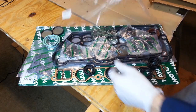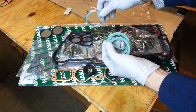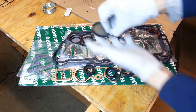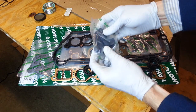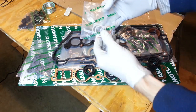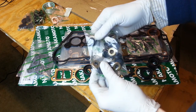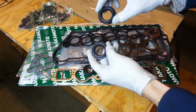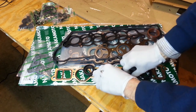I just want to show you the gasket kit that I bought — it's a pretty comprehensive kit. These are exhaust gaskets that go between the crossover pipe and the exhaust manifold. These are the housing plugs and the semi-circular plugs — these are made of rubber, but I think I'll continue to use the aluminum ones that came on the engine. These are valve seals, various washers, valve cover washers — a cup washer with a rubber insert, various O-rings and seals, and gaskets for the spark plug tubes. Mine weren't leaking and they're kind of a lot of trouble to change, so I may not do those.